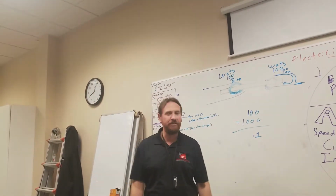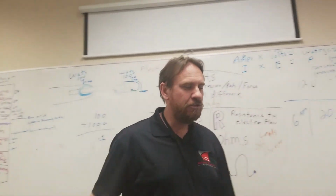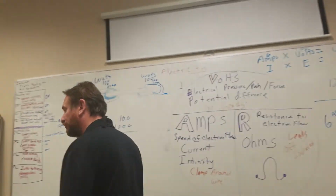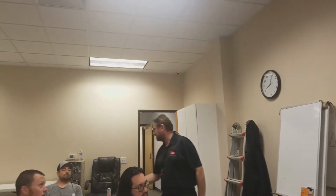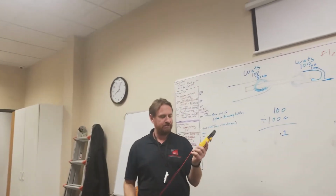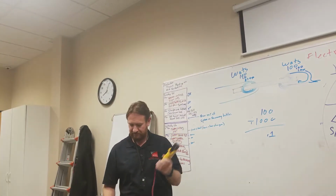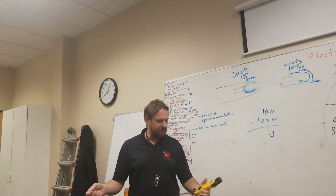All right. So far, so good? All right, before you touch the electrical circuit, you must make sure that there is no potential for you getting shocked. So I'm going to set my meter to potential. How do I set it to potential? Volts. Yes. So I'm going to set it for volts.